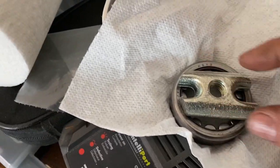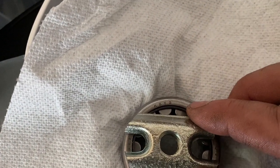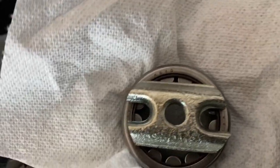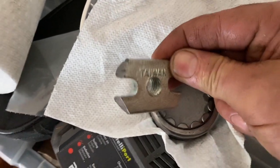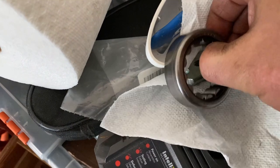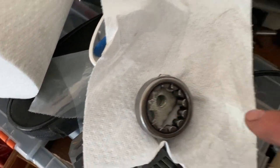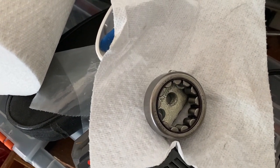Okay, I cut the ends off this old steering wheel puller. This is one of the new bearings, and it'll fit the edges. So hopefully I'll be able to weave this in and under the bearing that's in there, and with the bolt sticking out, pull that bearing out. Let's go give it a try.